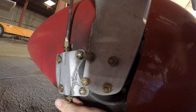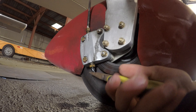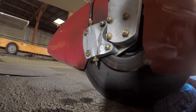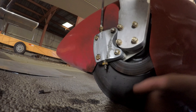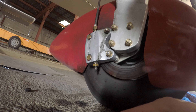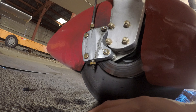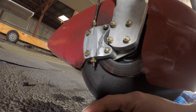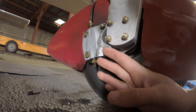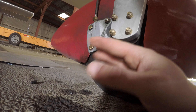If I can get this little cover off — there we go. There's just a standard little bleeder, and what we're going to do is hook up a little oil pump that's full of MIL-SPEC 5606 brake fluid — well, it's actually a hydraulic fluid, and that's what Groove recommends. I've heard of some people using ATF; it has very similar properties, but I'm just going to stick with the 5606 because it's what they recommend and what I have on hand. You just hook a little pump up and bleed it from the bottom up.